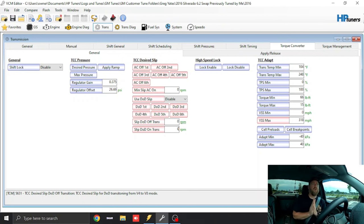If you want to stop there you're more than welcome to. Just taking care of the TCC slip and turning off DOD will make a world of difference in how your truck drives. If you want to go above and beyond, the first thing to do on a stock-style truck is to use Blue Cat Tool. If I can find a current website with this tool as a free download, I'll drop it in the description. If not, look for 'Blue Cat transmission tool' on Google.